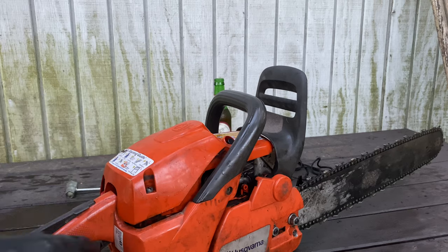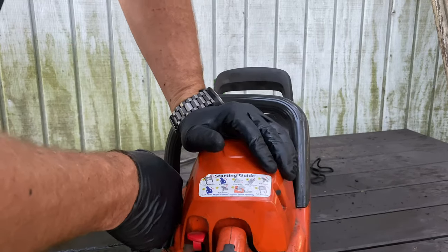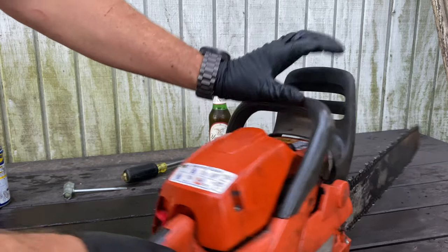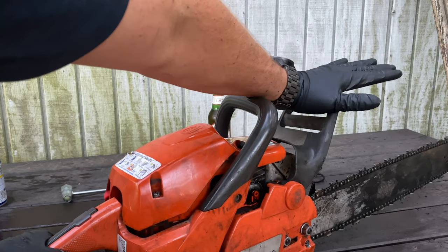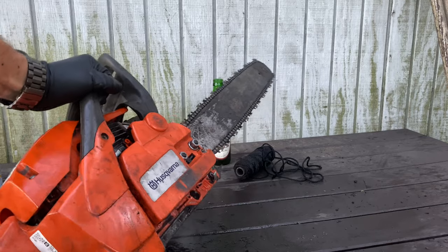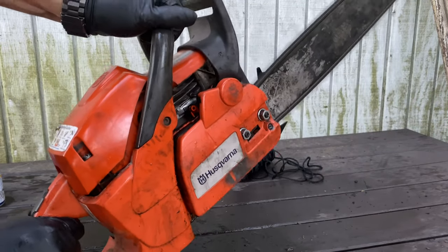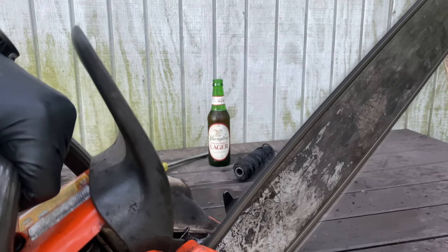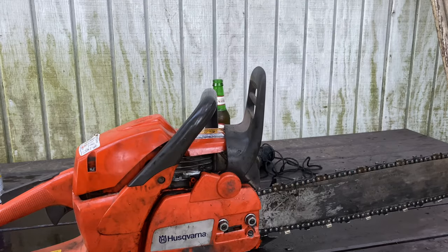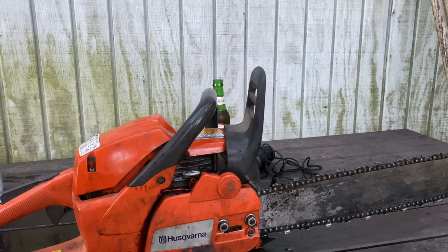Let's get some gasoline in there. Push it forward, spin it! Yeah, you got a little smoke coming out? That's natural — a little smoke coming out, don't worry about it. Push your brake back, get it back in the right position. You are done. You see how I have that slack in that chain? That's why you don't ever want to put it on super tight, because it's going to be a little tighter — and the first time you spin it, it's going to loosen up.